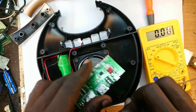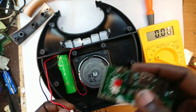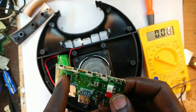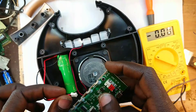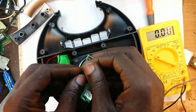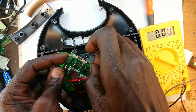So why doesn't it power on? These are the circumstances where the client misleads you — in his opinion he thinks it's the battery, but it's actually not. The dilemma is that this is everything integrated, so it could be a problem with that IC, and if so we can't help him — you can't get that IC around. Wait — had I plugged in the speaker last time I attempted to power it? No — I think that's why I didn't hear the sound. Let me plug that in and attempt powering on again. Nothing.